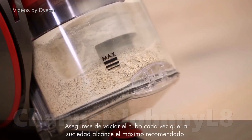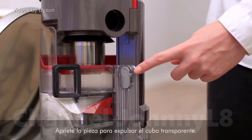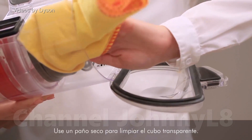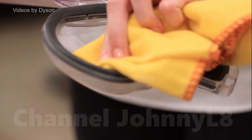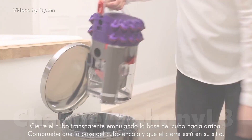Hallmarks of the effectiveness of this propaganda are to hear people worrying that the post-motor filter will clog, asking for it to be checked after routine user tests, and to see people psychologically more comfortable having access to filters so they can check and clean them unnecessarily. Again, this technology absolutely works exactly as claimed, as long as the machine isn't neglected and abused. No maintenance should be necessary to keep the machine sucking as well after 10 years as it did on day one. This has been repeatedly experimentally verified — it's truly great technology.